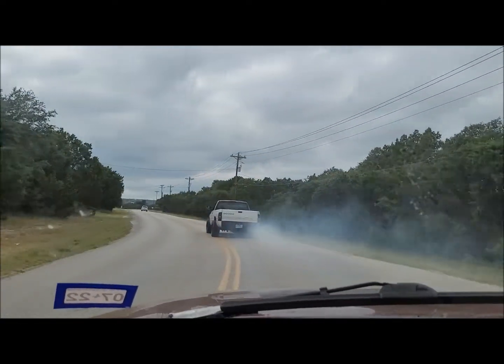Half-inch MPT is pretty standard for these sumps, FASS units, and Air Dogs. I think we're ready. I didn't put this piece in yet because it would be right in my face while I'm up in there. Got her all buttoned up — all this clean wiring under here. On these units, you've got positive, negative, and one signal wire which goes to key-on power. I checked with my power probe — I don't think there's any key-on power, these might be power all the time. Had to run a wire to the fuse box inside.